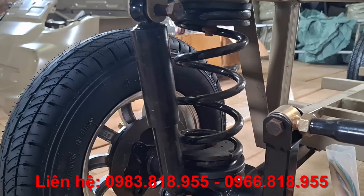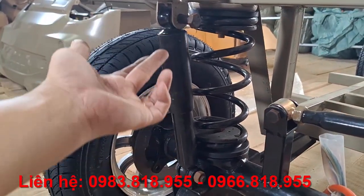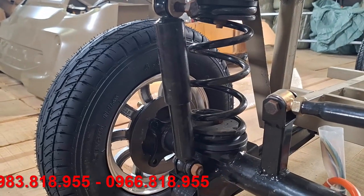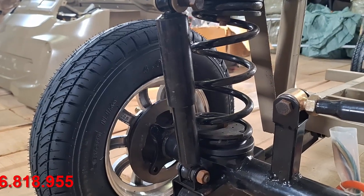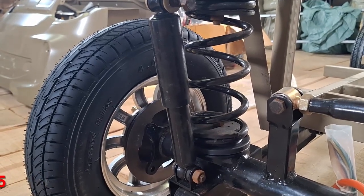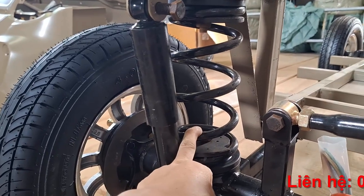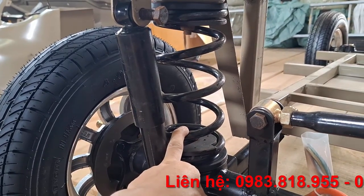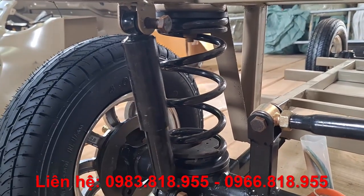This is the shock absorber unit — as you've seen in the previous video, when you pull it up there is still a gap, and when you press it down there is another gap. So when you install it, please note to pull it out slightly like this and attach it correctly to fit snugly. Because when it absorbs shock it will compress down, and when it springs back up, this will reduce the rebound jolt.